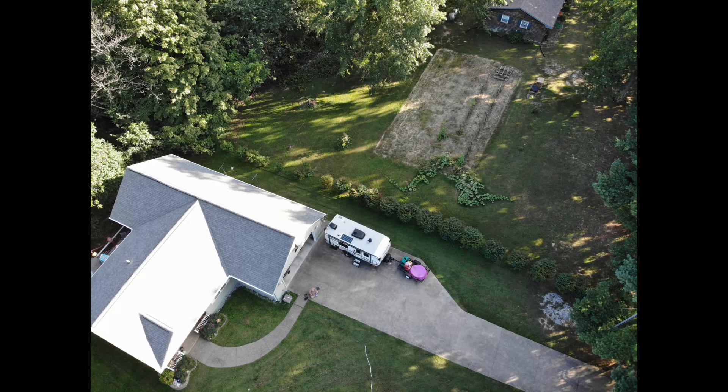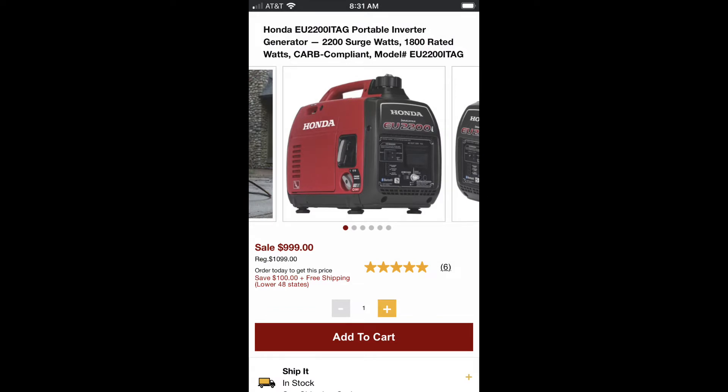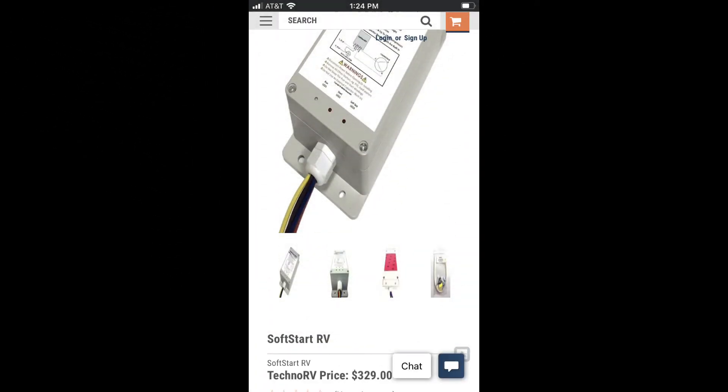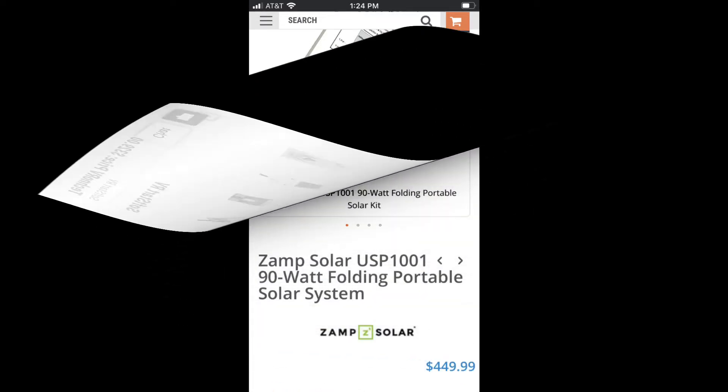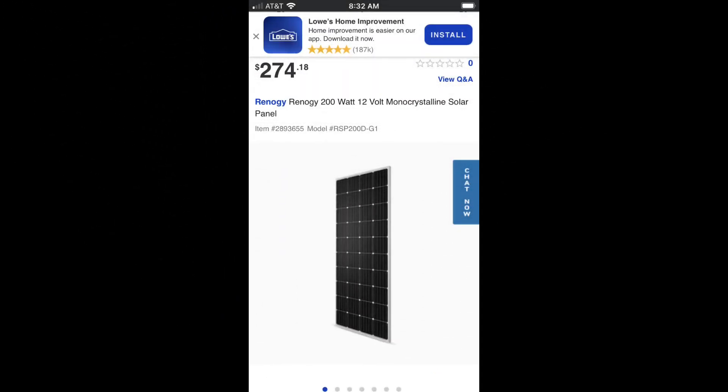If you live out west or want to stay up to a week, you'll want to look at other options. One option is a generator — a good-sized generator to run the air conditioner, though they're pricey and noisy. Smaller generators like the Honda are quiet but you'd need a soft start for the air conditioning to keep it from pulling too much power. Another option is portable side solar panels, though the downside is they're expensive and sitting on the ground when you're not there — a security concern. You can also add a couple of roof panels, which is more permanent but involves drilling holes, and in my case the cost and risk of drilling into the top of my camper is not worth it at this point.